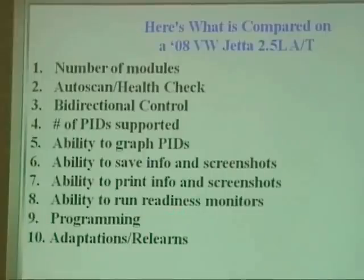Programming is a very important function in today's vehicle repair. Even if you have all the tools and ability, if something needs to be reprogrammed and you don't have that ability, you're not going to fix the car. Adaptations and relearns are also important — when you put a module in a car, you've got to marry that ABS, airbag, or whatever module to the rest of the vehicle.